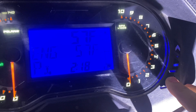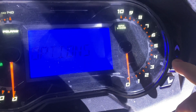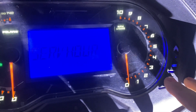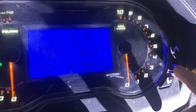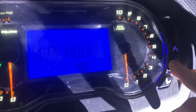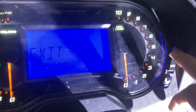Just to demonstrate how it works, I'll change the service hours to 40 — you'll notice when the display resets the service indicator is at 40 hours — then I'll put it back to 50. Hopefully you guys enjoyed this video and it gave you some good information. If so, make sure you hit that like button and subscribe to my channel. The whole concept of my channel is to give you the most information in the least amount of time, so I don't waste your time. See you next time!